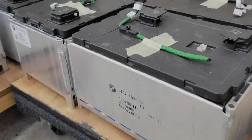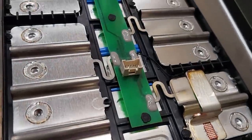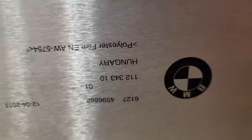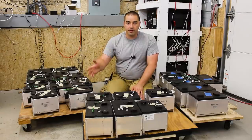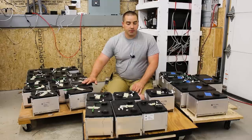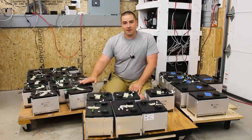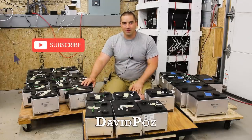The reason for that is this very thick aluminum case around everything — this thing is built like a tank. It's really impressive when you get up close and see these welds. Now 96 cells is pretty typical for an EV, giving roughly a 360-volt system, which seems to be what a lot of different brands do, although there have been a few exceptions. Overall, I really liked how they did this — they used a lot of very nice relays to turn the system on and off. I did a video on wiring up BMSs for these. I hope everyone enjoyed the time lapse of seeing how I took these apart. Check out batteryhookup.com with coupon code DAVIDPAWS — thank you everybody so much for watching.